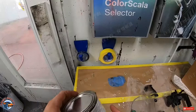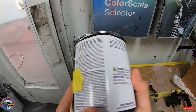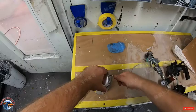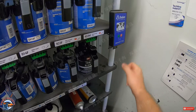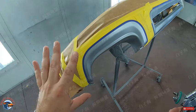Now the paint we're going to be using is SEM Trim Black paint. This also comes in an aerosol can. I'll put both links in the description. And this just mixes up 1-to-1 with any quality reducer. And I'll be applying it with a Sata Mini Jet because we have some tight little areas that we have to get into. We have our paint loaded up now. We're going to do about maybe 3 coats, but we're going to go very light on this first coat.